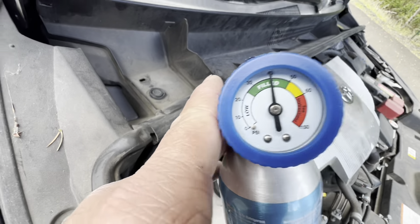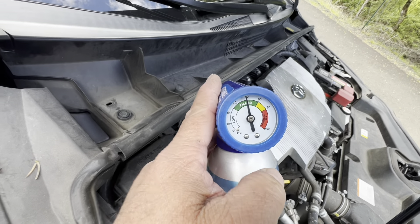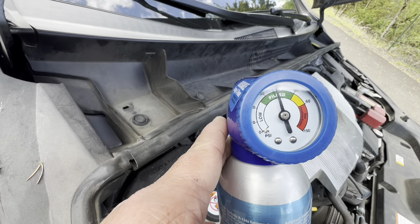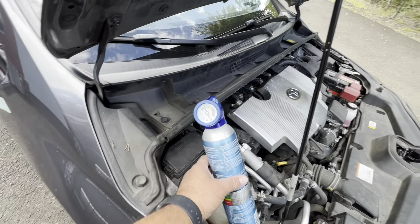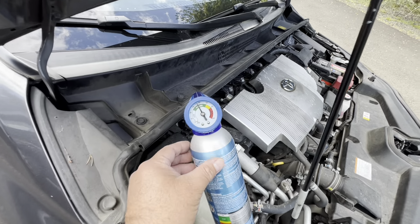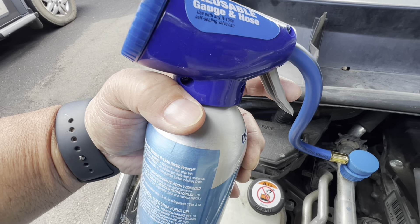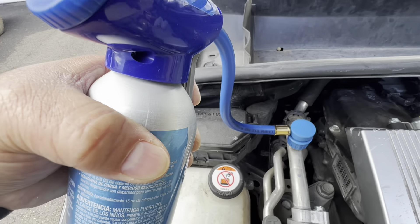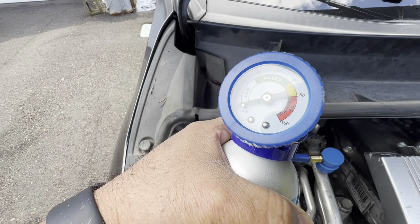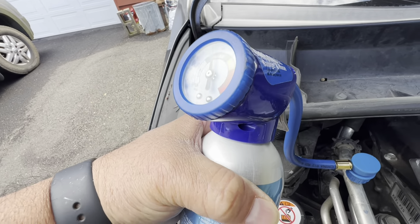When we go back to check, the gauge has dropped into the green. This is the gauge reading I go by — when the air conditioning is actually on and running. If it's in the green, you're pretty much okay. I actually filled it up a couple weeks ago, so I'm just showing you the process. If you need to add more, you squeeze the trigger and it puts refrigerant in — every squeeze adds a little bit of freon.